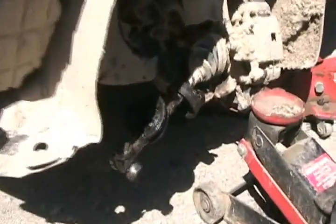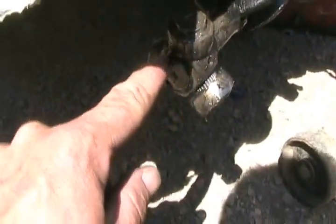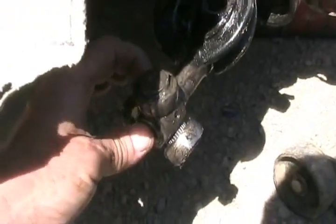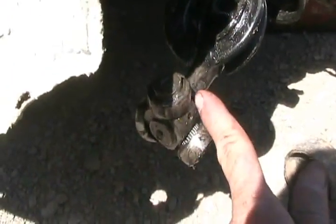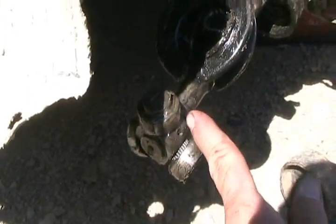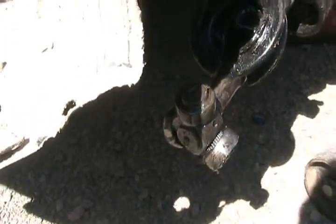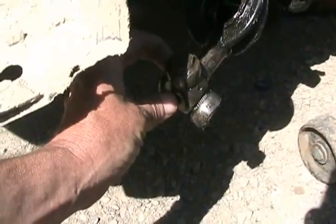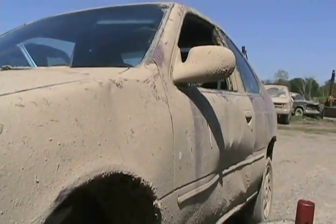Anyways, I've twisted everything all the way around. There's that knuckle that it separated, it's still in good condition. There's a locking clip on there that holds this little drive hub to the splines on the shaft. I think if I get that clip off, tap this thing out about halfway, weld it here, and weld it here, it's not a good fix for the highway. Good enough for my off-roads. I can get about maybe a half inch more length out of that axle. And this car will survive to die another day.